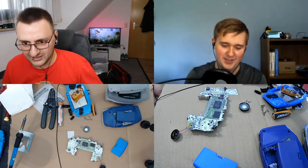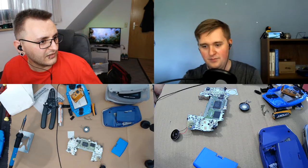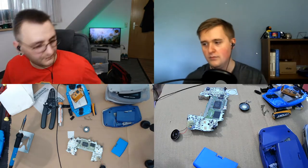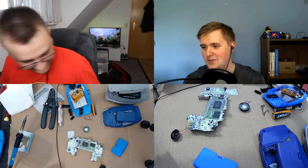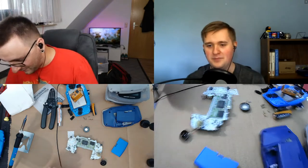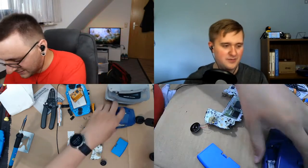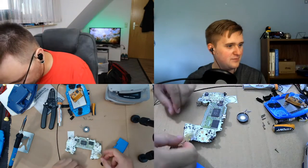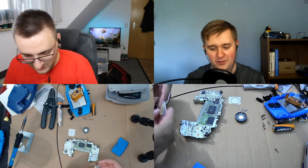Nope, no boot. I'm going to forward you the image I used last time to solder the audio chip so you can check I'm not messing up. That's how big this chip is — I'll put a screw on top of it just so you can tell. It has like eight or six cables on it that didn't come pre-applied. The first wire goes to solder point four — the one closest to the speaker. The second one according to position — no, it goes to a test point up at the top. The farthest away from the speaker goes to five.